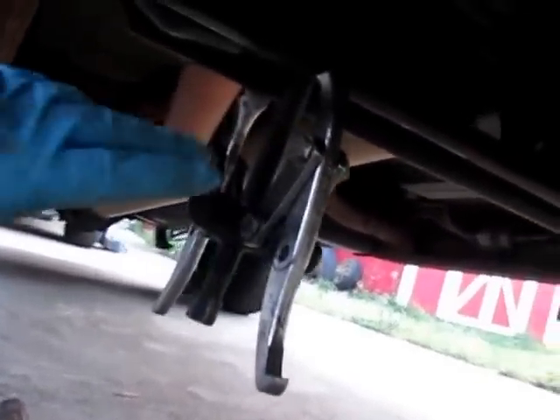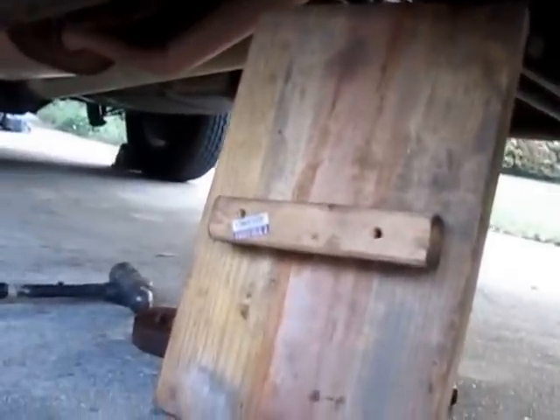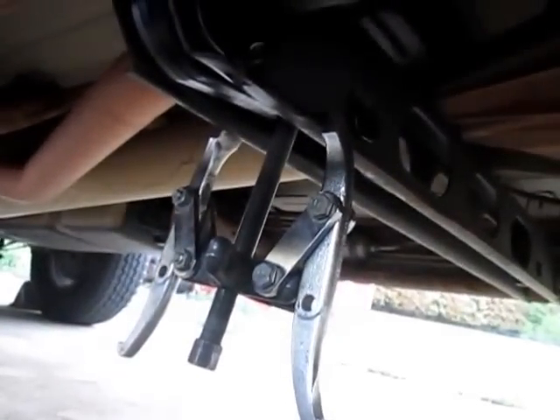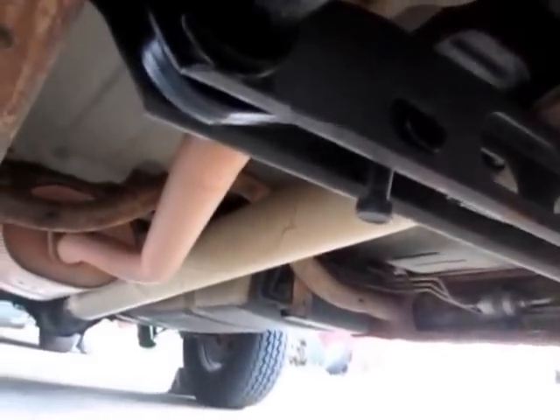I had a lot of side load on this, so I made myself a little shield — I wasn't going to have that thing spring off and hit me in the face or chest or arm. I put that up in front of me, put my knee up on it, and used my ratchet extension so I could tighten it up. Then I slipped the carrier up into the hole — it still has some tension on it, but it's in. Now I'll thread in one of the longer bolts, and that should take care of the passenger side. Bolt's in, got tension on it.